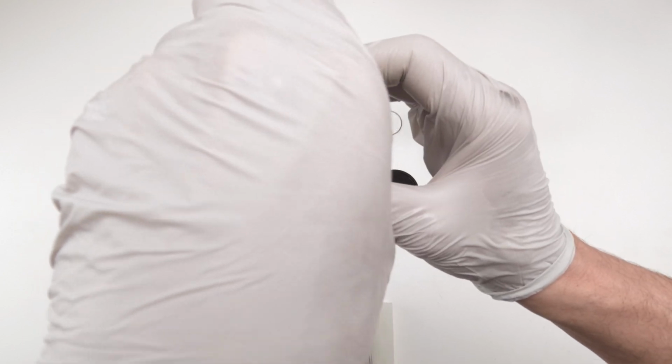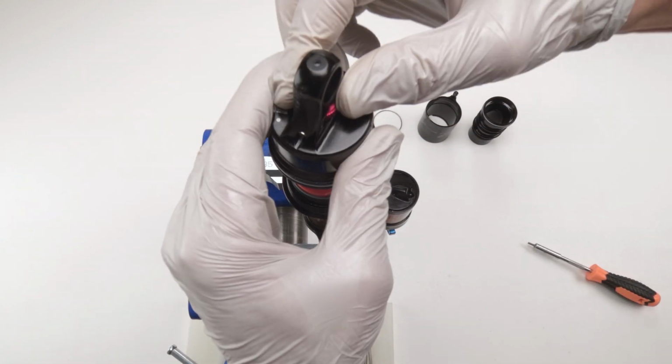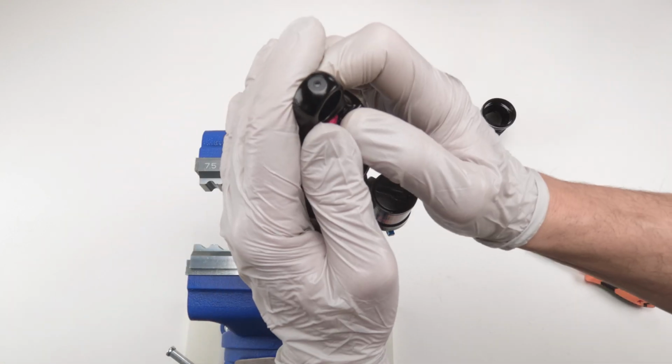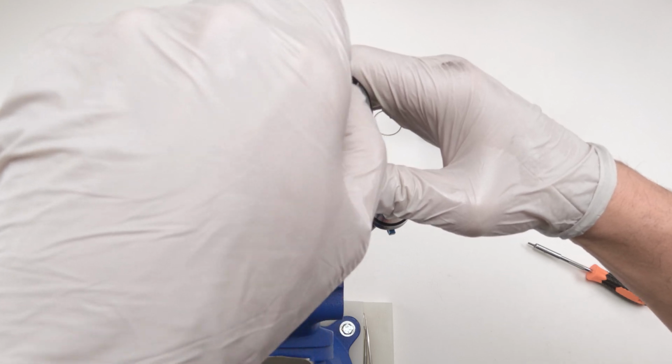Again, we could try the high-speed rebound, but you won't feel it. Just like there's not enough pressure in our hands to feel the high-speed compression or the rebound. You know what I mean? This is for fast jolts. So let's leave them in a fully open position.